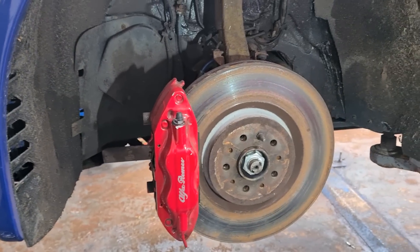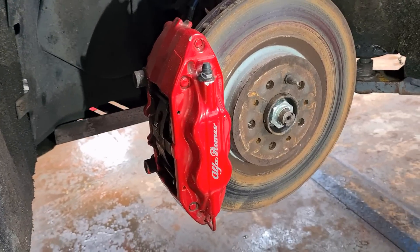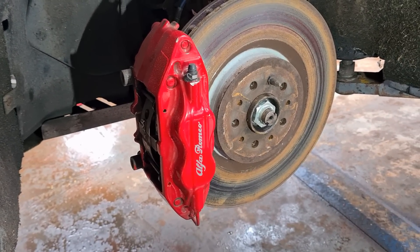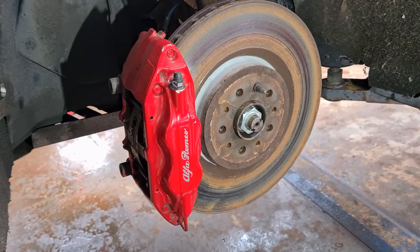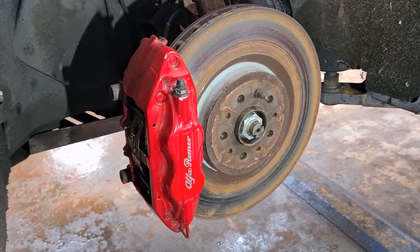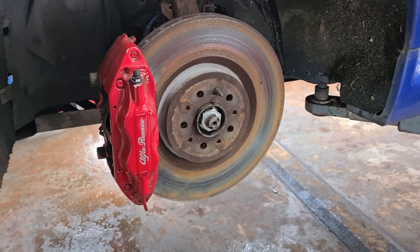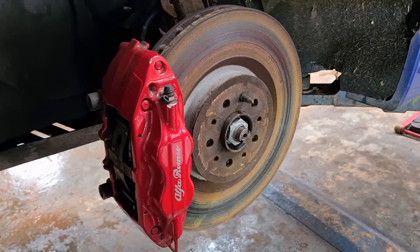On to the brakes, steering, and suspension. You always get Brembo brake calipers on the GTAs. There are two versions — the early ones were 305mm, and the best ones are the 330mm Brembo's which have much better stopping power, because the original reviews were complaining that the brakes weren't very good, but the 330s do make a big improvement.